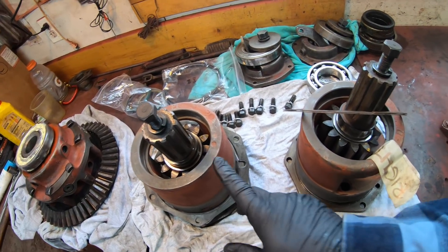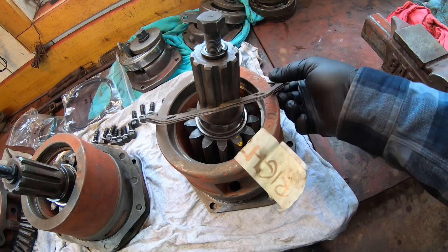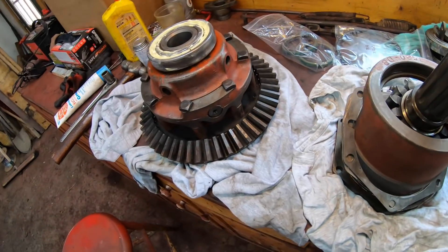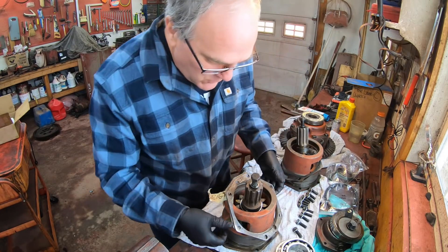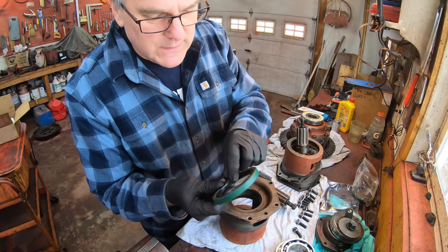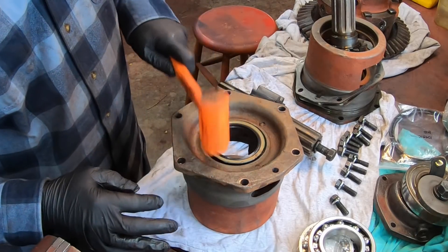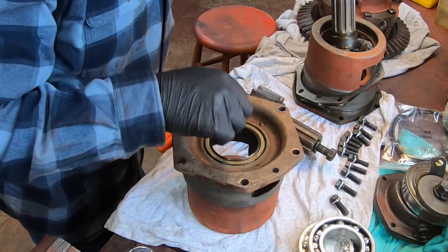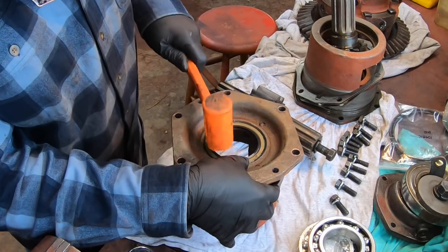The next job is to assemble these two pinion gear assemblies. I labeled which one was the right-hand one because we have to keep the shims together with the proper bearing assembly to ensure the right alignment with the ring gear. I'll do the right one first since that's the one that has to go in first. I have a new seal here—these are a heavier-duty double-lip seal. I've got lots of leeway depth-wise with these seals, and I want to move them down a little based on the wear pattern on the brake drums they seat into.